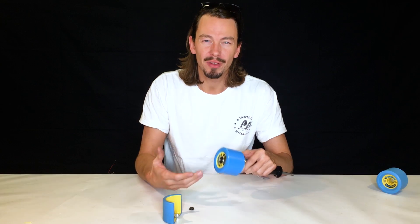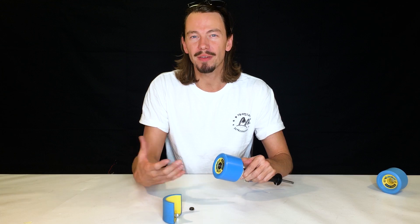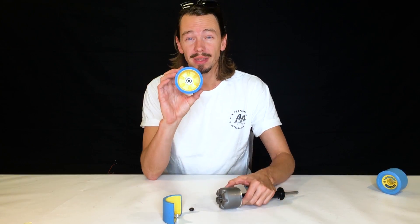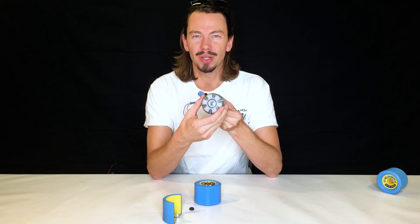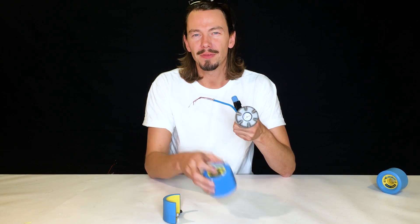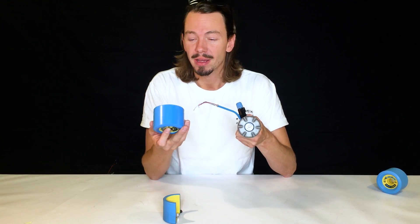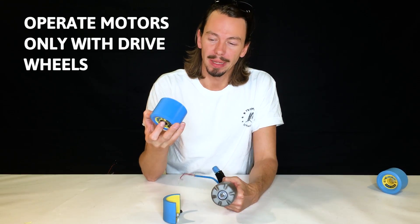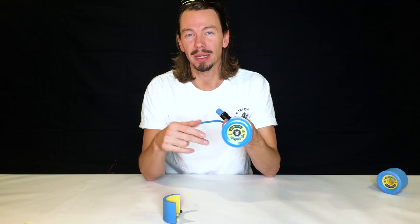If you have a motor that creates a lot of torque, you want to make sure that it's transmitted properly to the wheel in order to not have the wheel slipping. So we created these six locking points around here that go into the motor bell and therefore transmit the torque properly. As you're changing the wheel, you might find that the motor is not turning properly when the wheel is not on, and that is correct. The bearing seat inside the wheel, together with the bearing, aligns the motor properly — so as soon as you have your new wheel on, the motor will spin properly again.